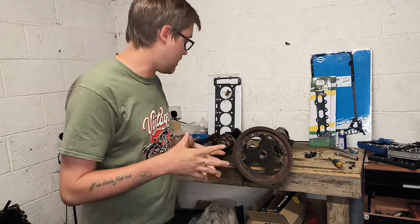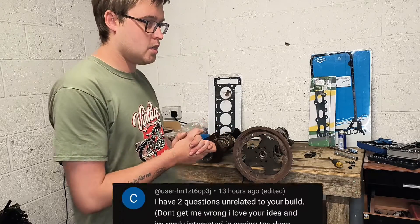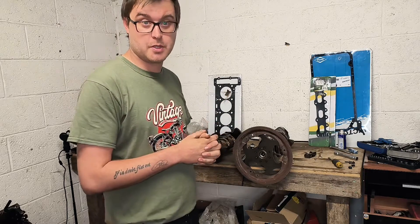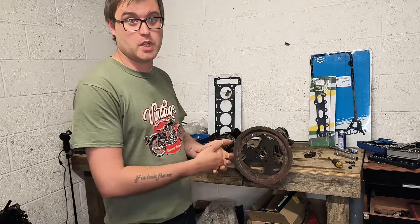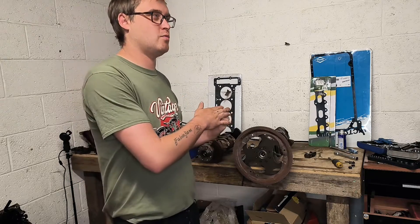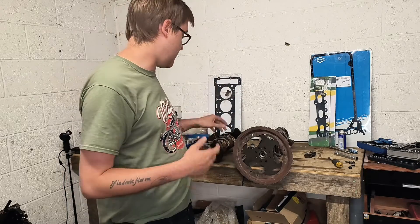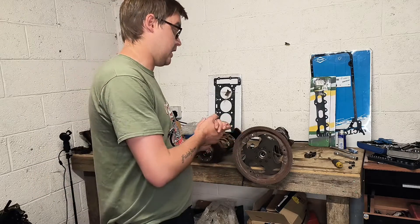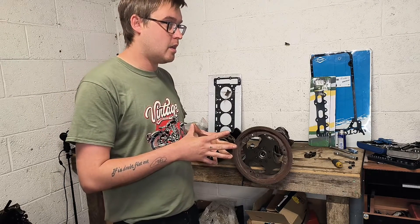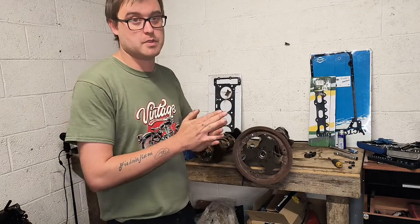The other question was: could an M111 rev to 7,000 RPM? With dual valve springs, yes — an M111 could rev that high quite happily. The other thing to consider is when you're revving that high you really want a lightened and balanced rotating assembly. There's a lot of weight on one of these cranks being thrown around, and the M111 has no balance shafts whatsoever, so it would not be ideal to do nothing with the crank.